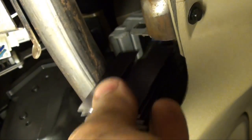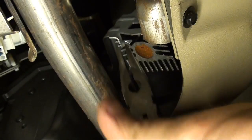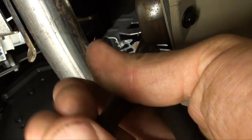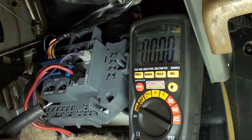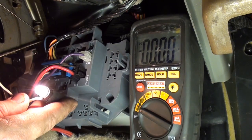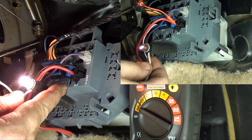I got the new one plugged in. I'm just going to take it and slide it up in place and see if I can get it back in its home. Get that slide back up — let's take and fold these tabs back over. Now with the new diode installed, let's see how it illuminates my test light at pin 87. Oh yeah, I think we got it fixed, guys. As you can see — known good, nice and bright. Pin 87, nice and bright. Big difference.